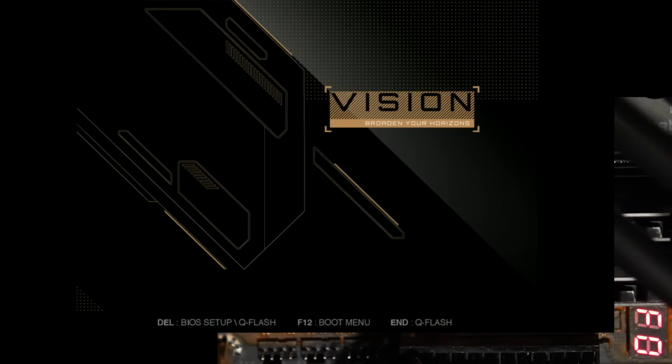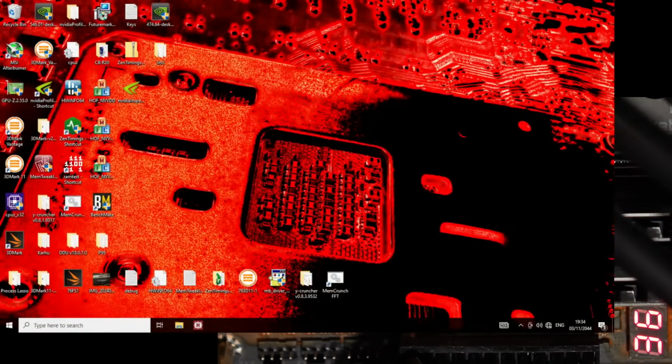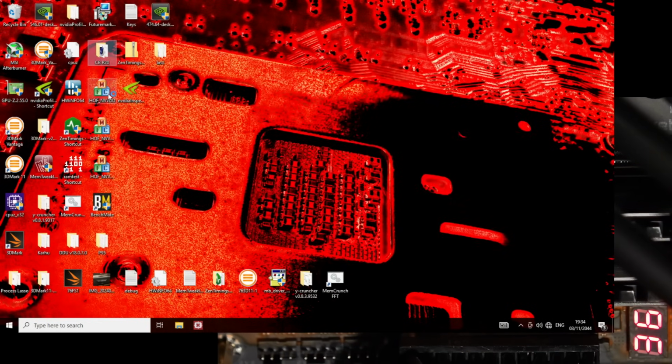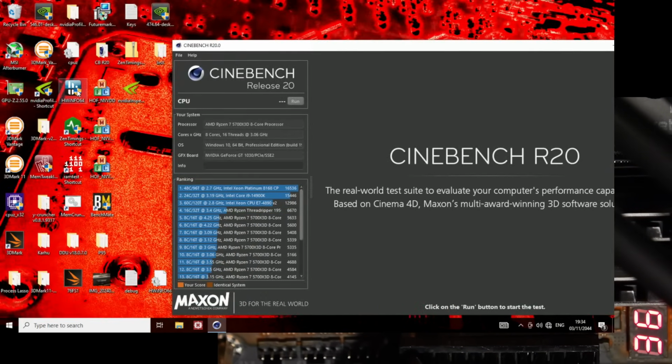But yeah, if you're buying a 5700 X3D, you can raise the BCLK by like 2 megahertz, maybe 3 megahertz, and that's it. If you do anything more than that, the CPU is just gonna no, you know. And honestly, I'm quite disappointed by that, especially because the stock core voltage is so damn high. It runs at 4 gigahertz, and it uses the kind of voltage that, admittedly, on non-X3D CPUs, you would expect 4.5 or something.